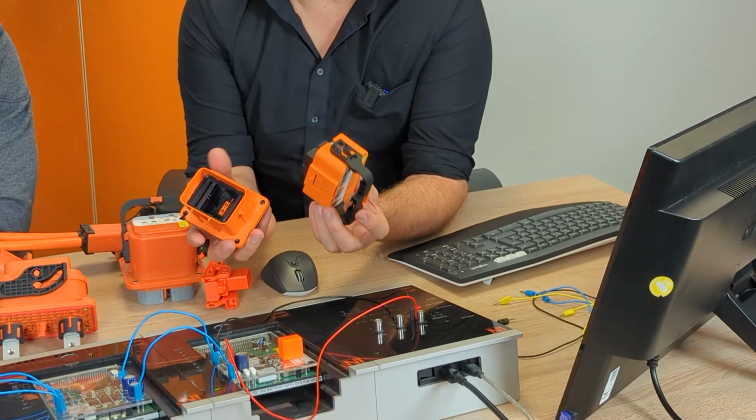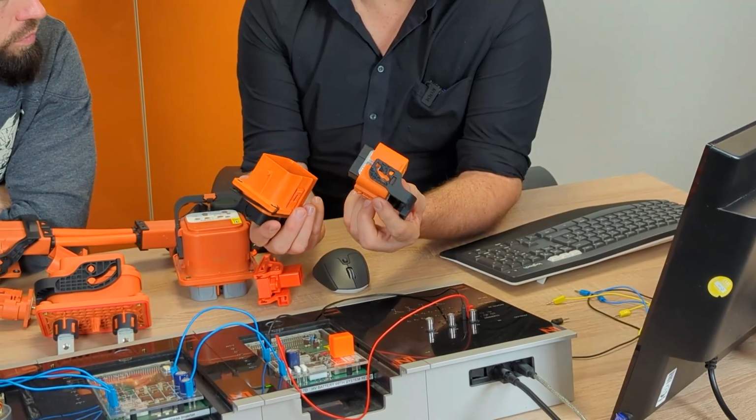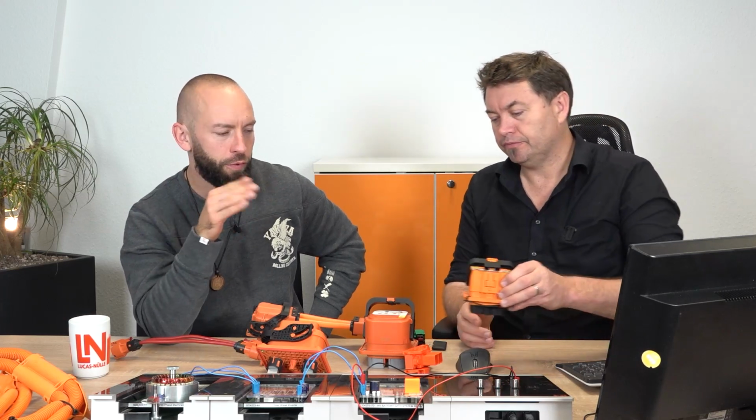That's the main advantage of these types of service disconnects: they not only disconnect the battery, this is kind of splitting the battery into 2 halves as well. Okay. So let's say the battery is at 400 volts. Yeah. This will split the battery into 2 halves. Some do it roughly 2/3 of the battery and another third on the other side. Some do it in halves as well. I think a famous example is Toyota Prius 3, where they did it like 1/3, 2/3 when they split it up, so not directly 50-50.